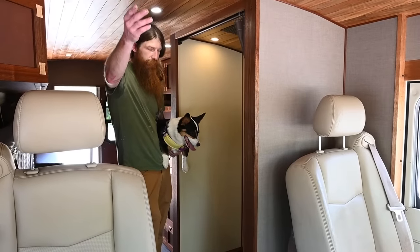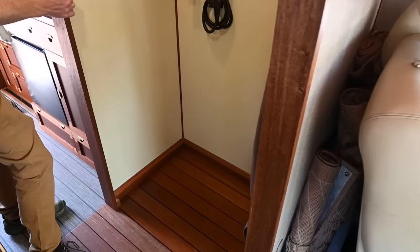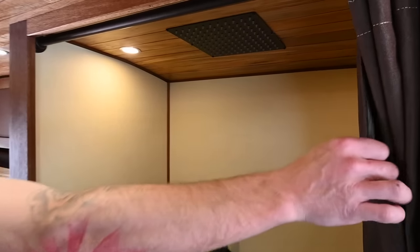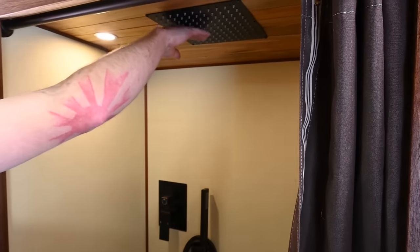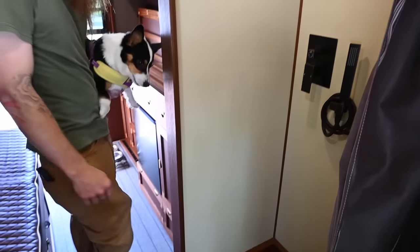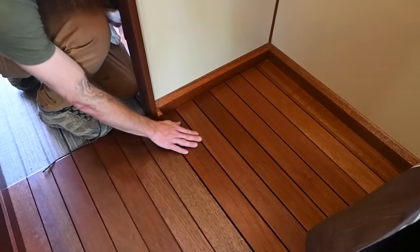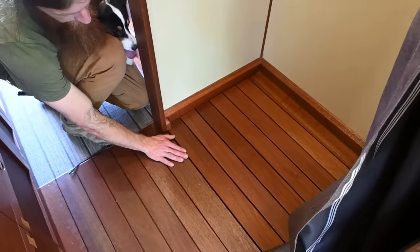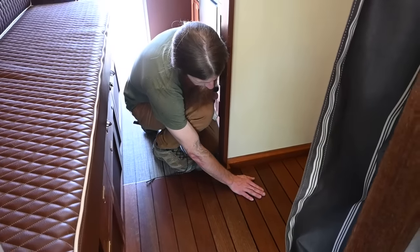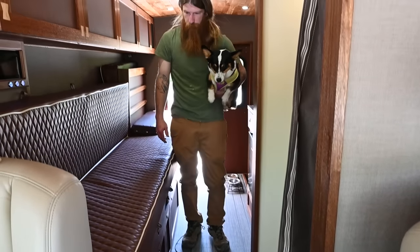Moving back from the cab, I was able to fit a 3-foot by 26-inch shower basin where I can actually store my toilet. All of the curtains here are magnetic. I have a rain-ring head shower with a diverter valve and a handheld sprayer. This shower pan is built into the floor — I did 2½ inches of poly-iso in the floor and the ceiling — so I was able to recess the shower pan down below for a seamless transition from the shower to the main walk area.